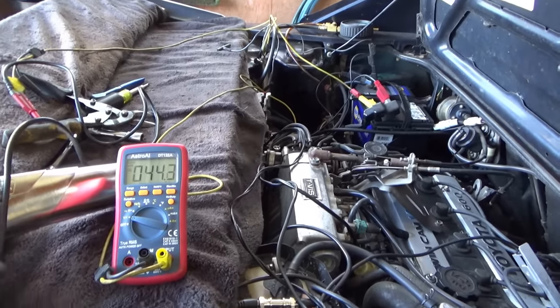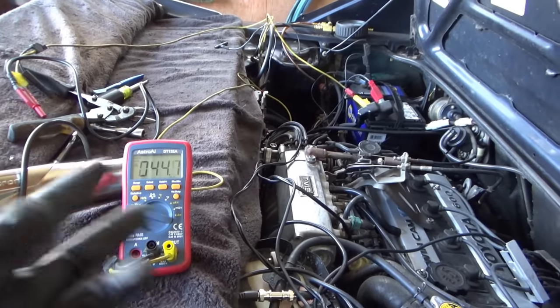So how do we check fuel trims without scan data? The multimeter here is on the oxygen sensor signal wire and my test light is connected to battery positive. So if it finds ground, it's going to light up. I can use this to pull up the oxygen sensor signal and we'll see how the computer reacts. I want to keep the engine speed stable, do that experiment, and see if it starts running better or worse. That will tell us: are we pegged lean or rich? The oxygen sensor at idle is always just stuck lean. If we pull that signal up, the computer will start subtracting fuel - if it was running rich, it will run better; if it was already running lean, it will just stall out.